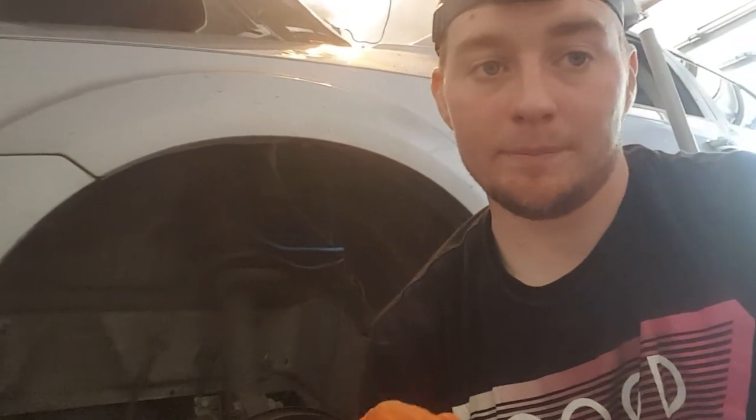It's almost better to just spend the money on a new battery. If it dies on you once, get it jumped, charge it up, and once the alternator hits it again it'll probably be fine. But if it happens more than once in a week, get a new battery. You're going to leave yourself stranded trying to ease it along — the battery is going to die in the most inopportune place at the worst possible time. Nobody will be around to jump you. Don't do that.